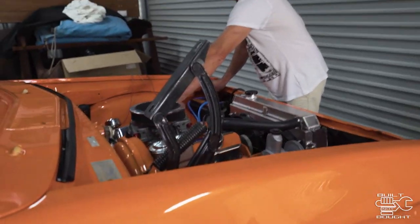It's another exciting time. Obviously last time we got the engine running, so what we're going to look at today is the process of getting it to the point of its first drive. Taking the thing for its first run — really what we're looking at is bedding the engine in, so it's got to be driven under load. We're going to look at towing something up the road so we can really bed those rings in, then making sure the gearbox works correctly, we've got brakes, we've got clutch, all those sorts of things.